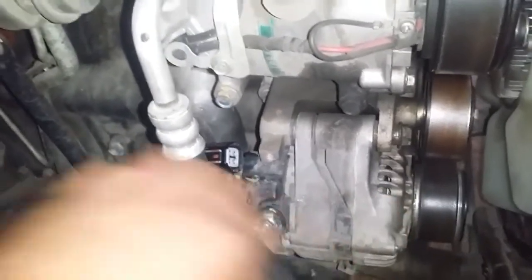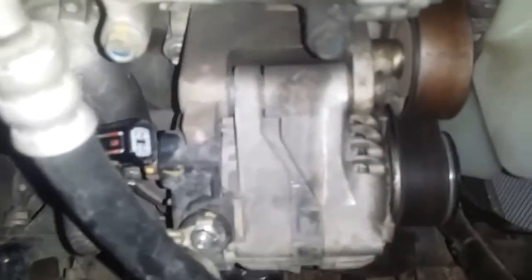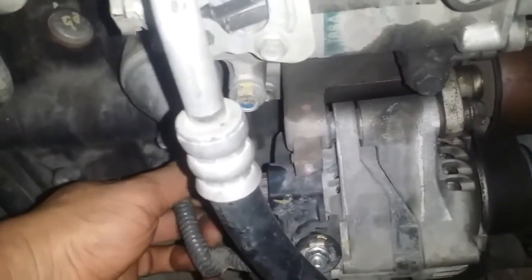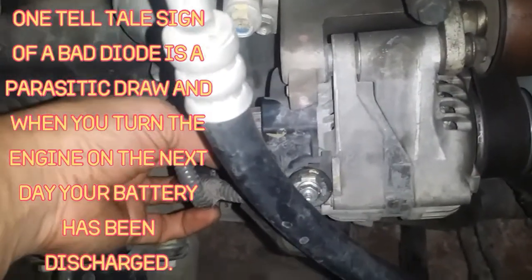Before we remove the alternator, let's perform a few more checks. Usually when your alternator whines loudly it's caused by a mechanical noise from a worn out pulley or bearing inside the alternator, or a bad diode problem — and that is electrical noise. One simple way of checking for electrical noise produced by the alternator is to start your engine while the harness is plugged in. Should the whine occur loudly and then stop when you remove it, then you have electrical noise, and in most cases that is by reason of a bad diode problem.